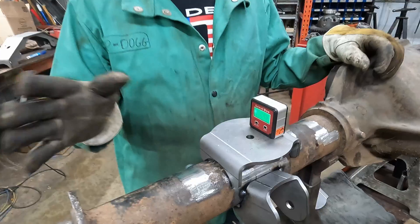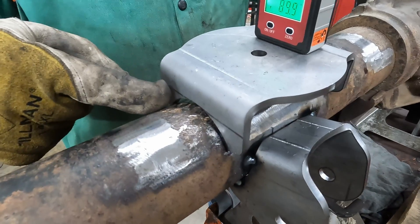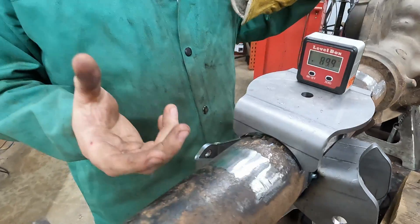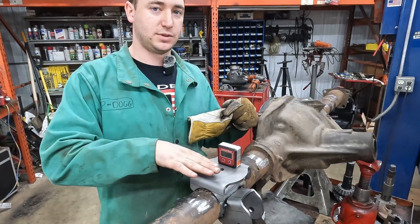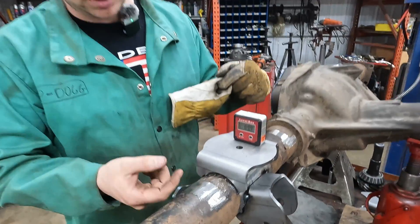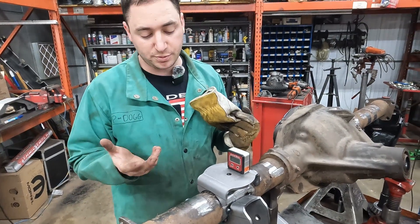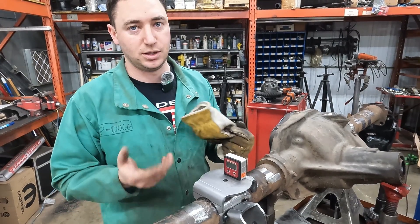One thing I want to point out — this was a leaf sprung rear axle, so that pitting we had underneath our leaf pack block — you can see there's a little bit of gaps under there but our ends are touching. Now if yours is pitted out worse, or is putting your bracket down in a dip, you want to bring this up so it's flat. Then you can tack it in. We're not going to fully weld this all the way around. The instructions call for a one inch stitch on each corner on the outside. You don't have to get crazy with this — they're not holding a ton of shear pressure or anything like that. Just pay attention to the pitting, make sure everything's level, tack it in place, and get your stitch weld done.